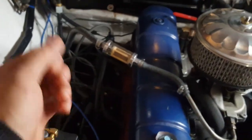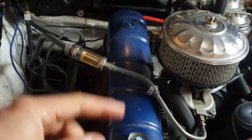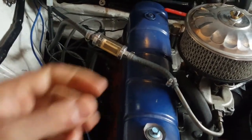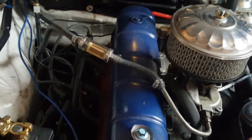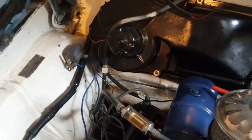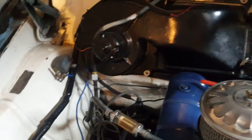testing procedure here. And the way I sort of figured that there was a problem is that the car was not going into reverse. I couldn't physically move the gear lever into reverse. And it was very hard to put it in first gear. Even though I put it in first gear, it would take off very slowly. Again, probably because the overdrive was on. Fortunately, I don't think I damaged the overdrive, because I drove the car normally and there wasn't any crunching, no noises, nothing, so the overdrive should still be fine.